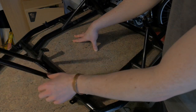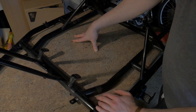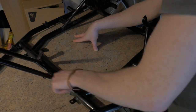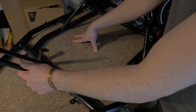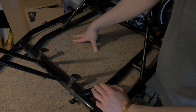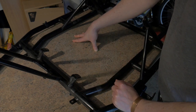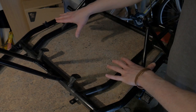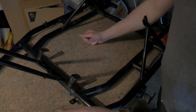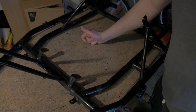The chassis tube thickness - I don't have to worry about any of that kind of stuff. Another thing is on the OTK, this strut here, this upright for the fuel tank, is quite a complicated set of bends. So what I'll probably do is emulate this - I'll just have two straight tubes with a slight kink in them, and fit a standard fuel tank. It's just going to make my life so much easier. The whole process here is making my life easier. So that's probably what we'll do for the rear end - it'll just be a sort of clone of what we have. The front end will be a little bit more interesting.